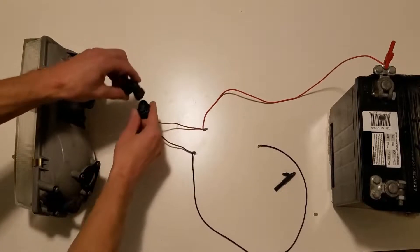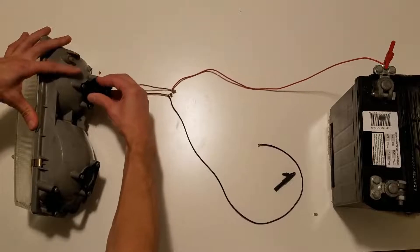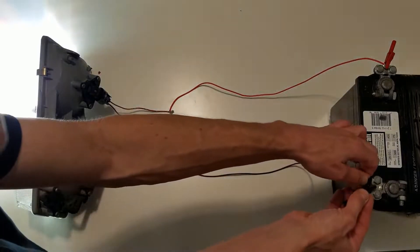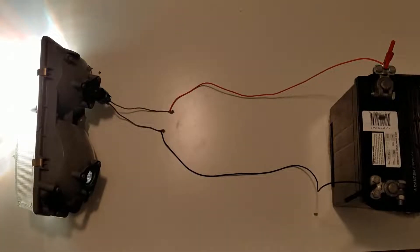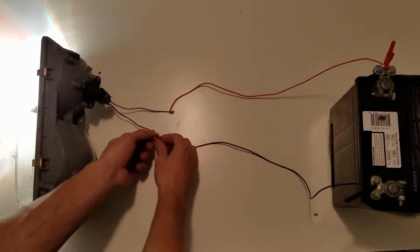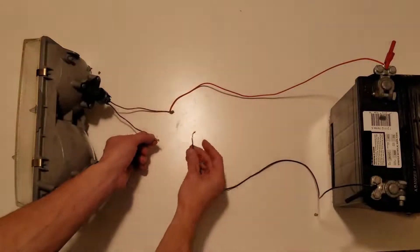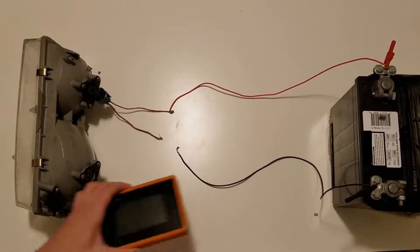I'm going to reconnect my headlight connector to the bulb and put that back into the lens assembly, then connect the negative side of my battery. We get a little spark because we've got a high current here — about 4.5 to 5 amps, which is why we got that spark. We can see that the light bulb does turn on and everything in the circuit is working. Now I'm going to create that open. An open is simply where our wires no longer make contact. I'm going to start on the negative side and pull that apart — and now we have an open in the circuit. Obviously we can see that causes the headlight to turn off, and we're going to use Devo to diagnose this.